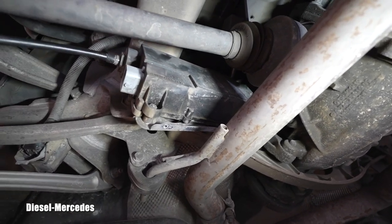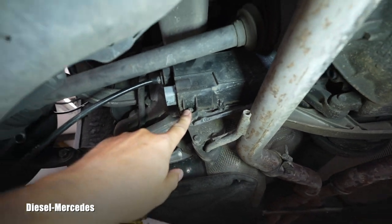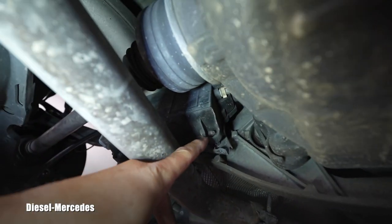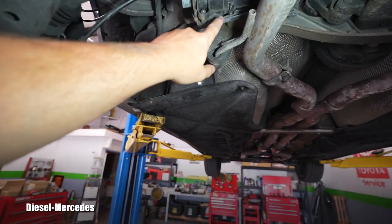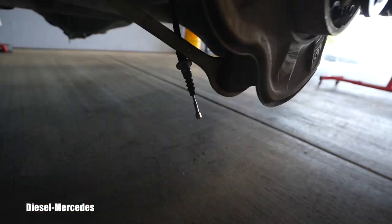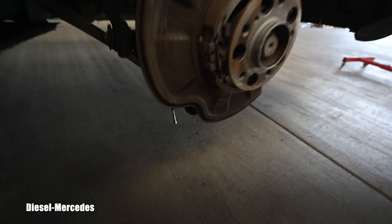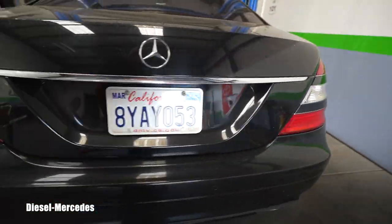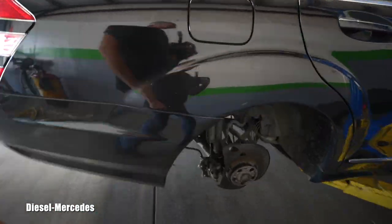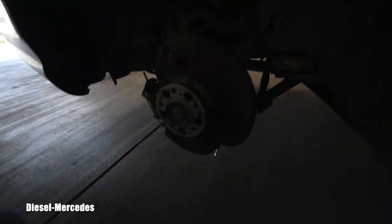Here is the view after removing the protective plate. I'll be removing three 10-millimeter nuts rather than removing the entire backing plate, because access is difficult. I positioned the cables so they're in a similar position on both sides, and then I tested the brake system from the cabin to see if it would still show a malfunction.